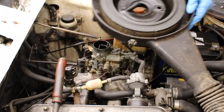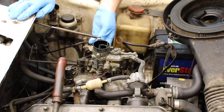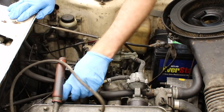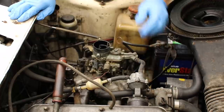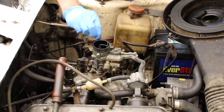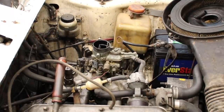On a car like this you've got to be so careful not to damage anything. Those hoses are just hard as freaking steel. We've got a big vacuum line coming from here going to the distributor, then we got some linkage. That fuel line on there is really soft, but this one's not. Got some stuff plugged off on the manifold, so somebody's been deleting some things. We got the linkage and the return spring here. There's a couple straight slot screws to take off.